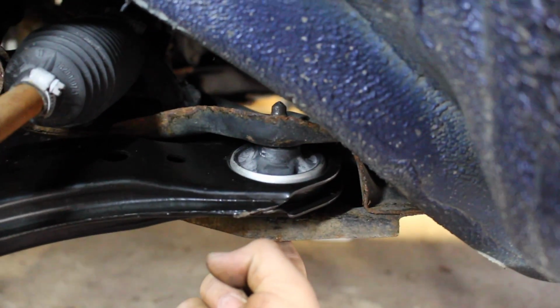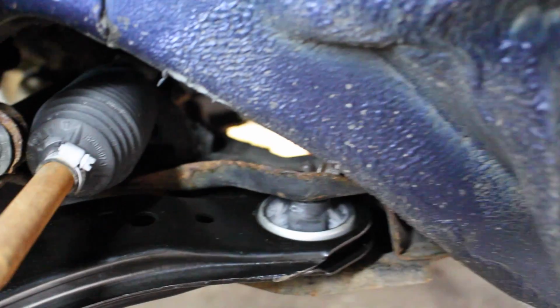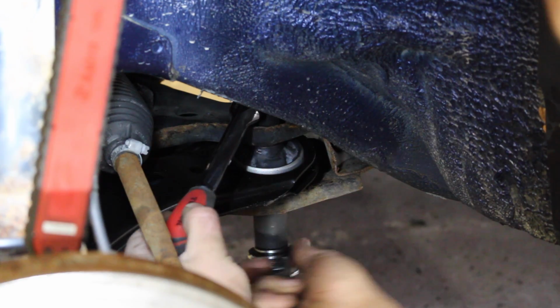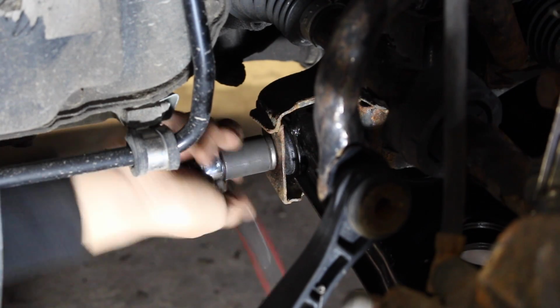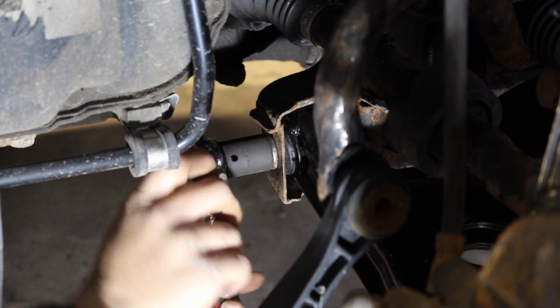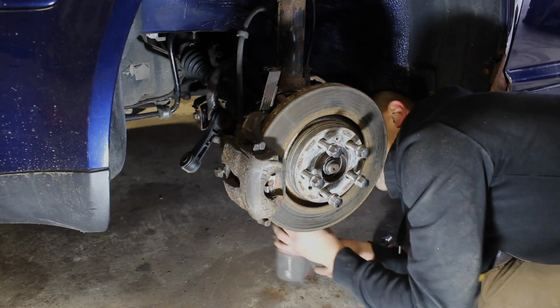and then make sure that you tighten this up properly with your nut sitting on the top of it. I didn't really do it right there, but you get the gist of it. Put that through, and then tighten up that nut on top. After all of those bolts are in there hand tight, you can then proceed to tighten them up with either hand ratchets or an impact gun to make sure that they don't move down the road.